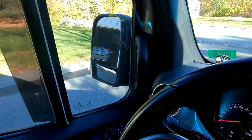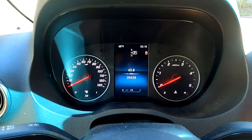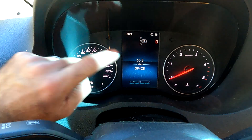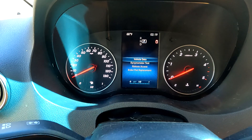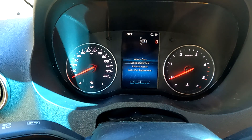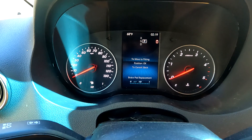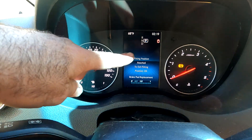Before you get started disassembling the rear brakes, if you've got an electric parking brake you need to set it to the service position. First, park the van — we're in P — and make sure the parking brake is off. To access the workshop menu, go to the total mileage display, hold the back button for two seconds, press the trackpad, and this menu will pop up. Go to 'brake pad replacement' to move to fitting position, push the trackpad, it will say 'moving to fitting position,' and then you wait until it says 'fitting position reached' and now you can go to work.